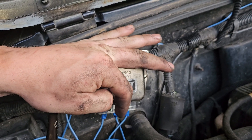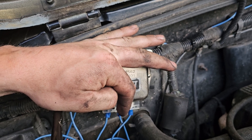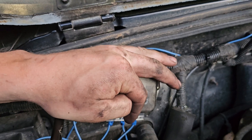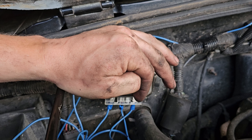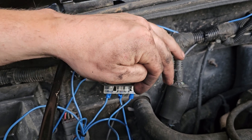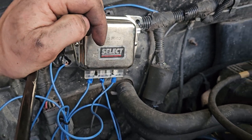The 'A' wire goes to the power wire on the back of your alternator. I also suggest running a new power wire from your alternator straight to the battery at the same time. You can fuse it if you wish — I don't usually fuse them, from my old car audio days — but if you do fuse it, use at least 100 to 300 amps.